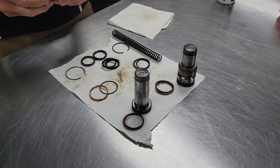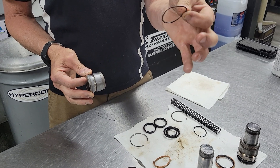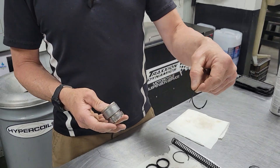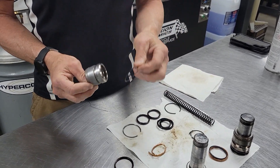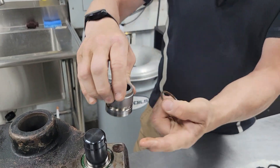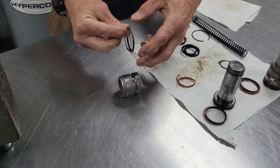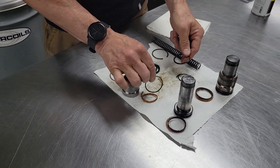Everything on the bearing, you can screw up — so you need to pay attention. On the outside of the bearing there is a flat rubber seal. By the way, somebody got into one side of mine, put all wrong parts in, and it was a mess. But this is the stuff that just gets absolutely shot. There's a flat black rubber washer, which is titled just 'ring' as a part when you buy it on the parts explosion. That part goes on the outside, closest to out, and the big O-ring goes under it. They sit on top of each other, sandwiched, and they ride in this groove. The flat black rubber washer goes up and out toward the circlip.